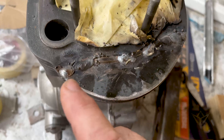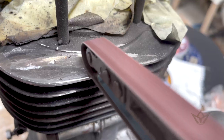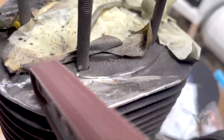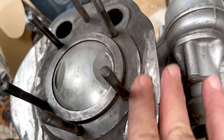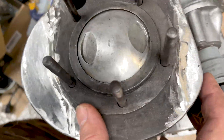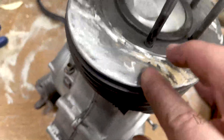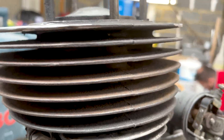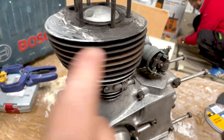I'm going to clean that off and see how close I can get to the original base metal without compromising the weld, because that is ugly. You can see the fins line up with these edges here. I've brought the weld back as much as I can. I also found another crack in the original cast iron, which I've welded — so that's good. I've rounded this off; I'm really pleased with that. The thickness is good. I just hope it doesn't come off. Now we paint it, clean the engine off, paint it black, and you will not see anything.